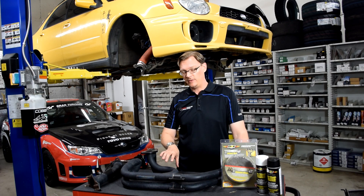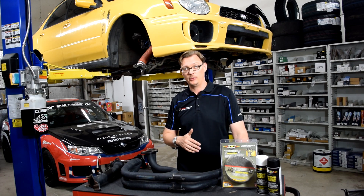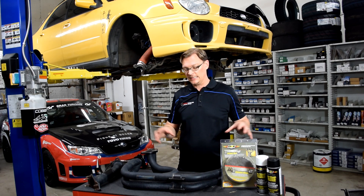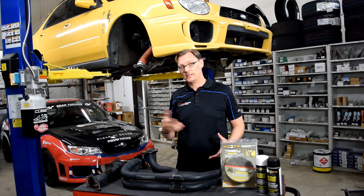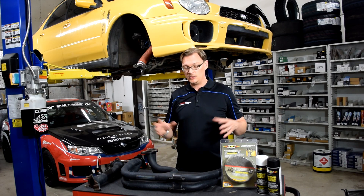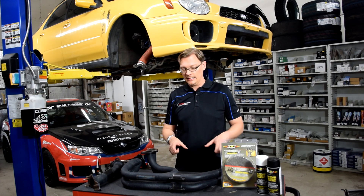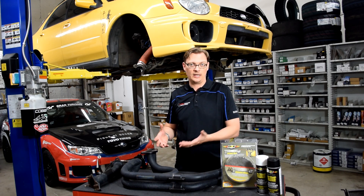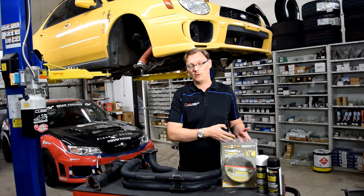The other reason is that you've got the ceramic coating as one thermal barrier, and then in addition you're putting on the header wrap, which is even more effective than either one by themselves — keeping all of the heat in the exhaust. Over time that can put more of a thermal load on the header itself, and doing that aggressive heat mitigation can actually put more stress and possibly cause it to crack at a flange or weld sooner than if you had just ceramic coated or just header wrapped it.